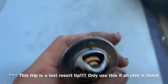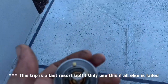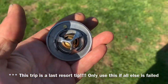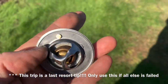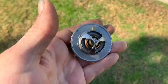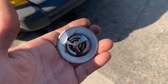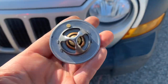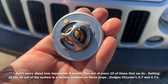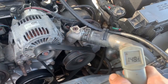Let's say you can't seem to get that lower radiator hose to allow coolant to flow through it. You could take a one-eighth inch drill bit and drill approximately three holes in the outside portion of the thermostat. That will allow coolant to escape past the thermostat itself, allowing you to burp it out easier, and you'll still have heat and coolant movement, allowing that air to escape. This might be necessary if you had a small head gasket leak or something like that. Having a couple of holes in this probably won't hurt anything — it will still go up to operating temperature and work properly.